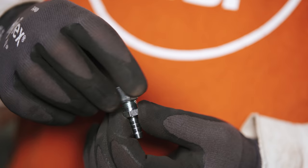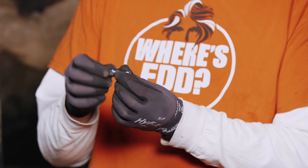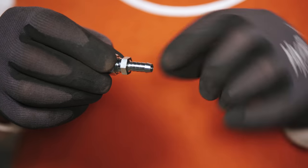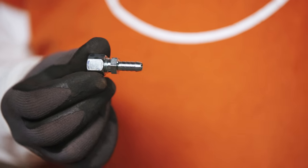When it comes to what I put on the ends to attach the hoses, I have a couple of options. I've got a fitting like this which has an olive inside — you pop it over the end of the cunifer and crush it down to make a seal, with a barbed bit on the end for the hose. But they're quite chunky and don't look right; they're not really how it would have come out of the factory.